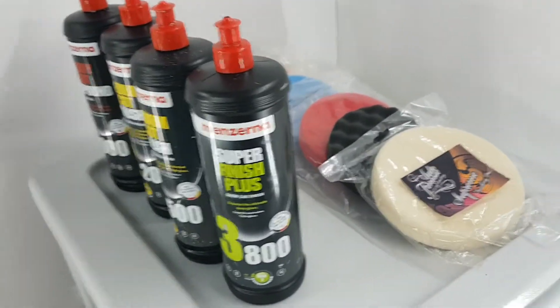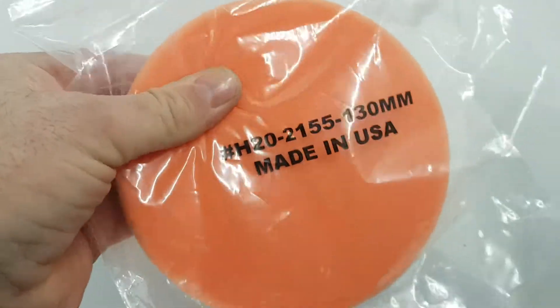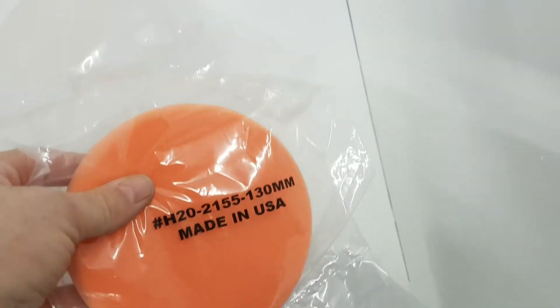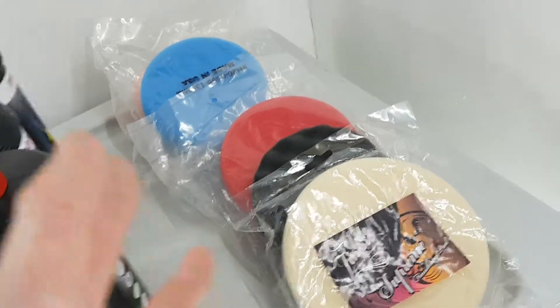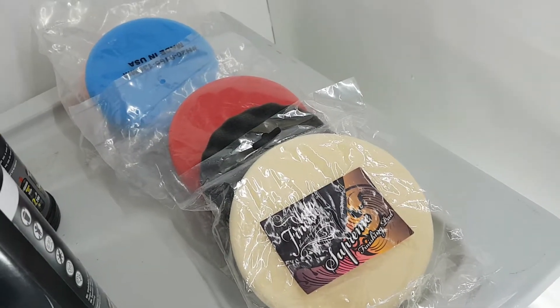When I say I'm going to do a five-stage polish it'll be with a super fine — finer than the super finish plus. The pads come in different types: a solid pad would be used for heavy cutting, used if your car has deep scratches. We have to assess the damage on the car before we determine what pad to use. We test for the least aggressive amount of cut needed to remove the defects. This helps preserve the thickness of the clear coat — if you break through the clear coat it's got to be repainted, so we don't want to break through.